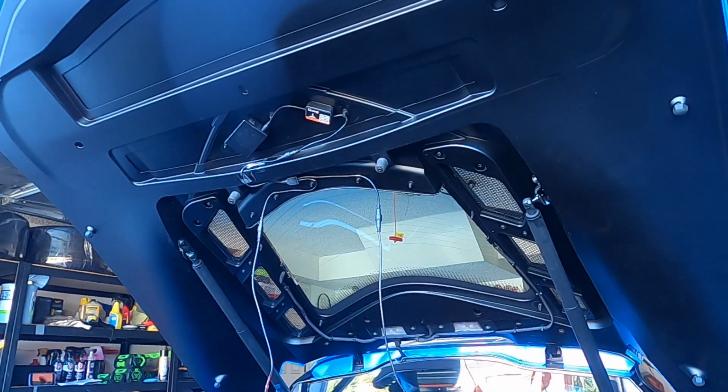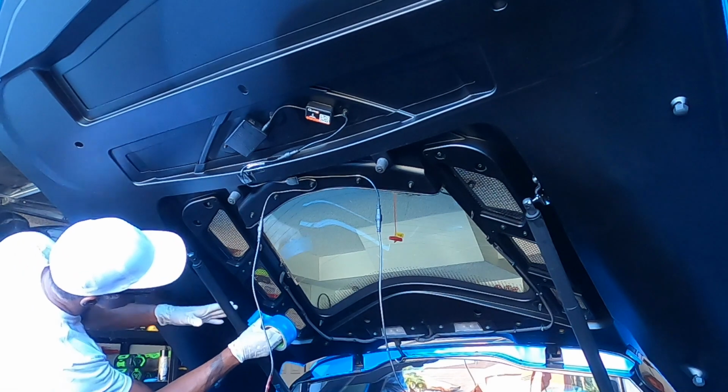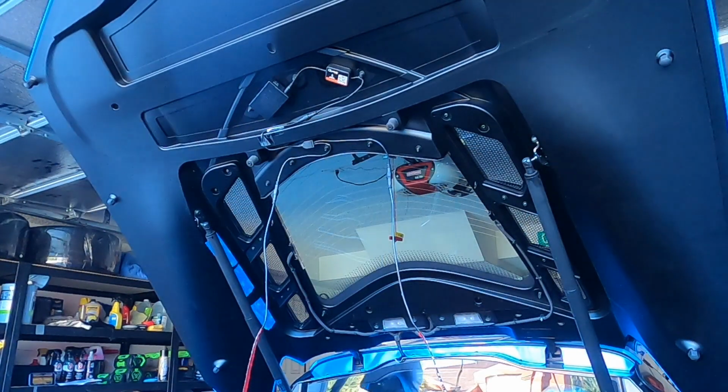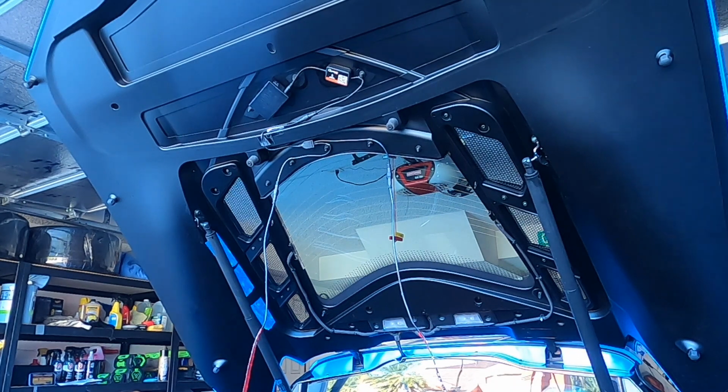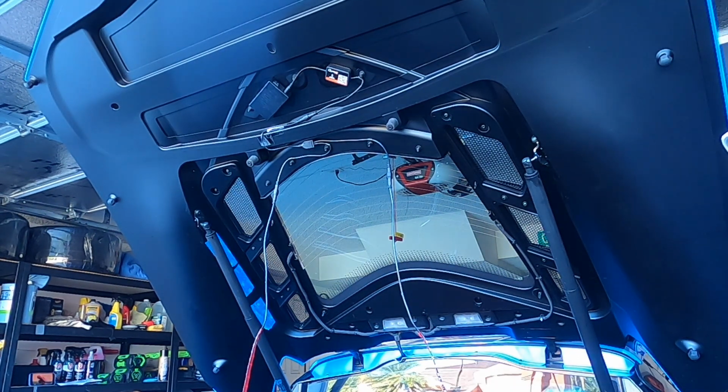And then once we do that, I'm going to go ahead and place some masking tape as a guide. Now I chose to place the masking tape exactly one inch from the bend inside of that area. You have to really see it up close, but I'm basically giving it an inch, and that's where I'm going to mount my LEDs.